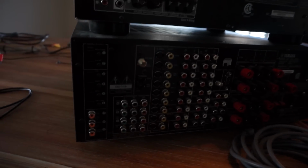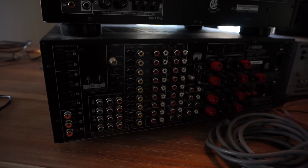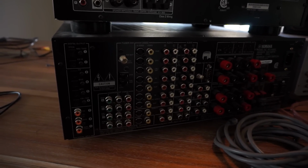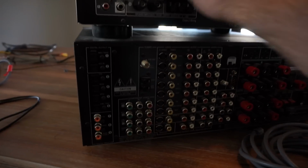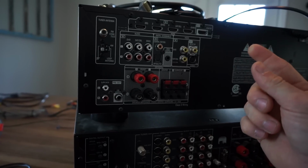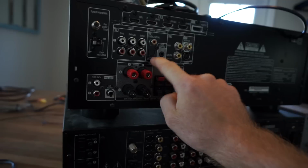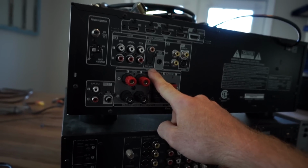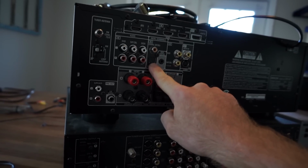So really pay attention to what you're buying and how you're going to connect it. I'd say if you're going to go buy something, make sure it's going to connect correctly. You can look up the user manuals online and see what it needs. Most likely on a TV you're going to want to have HDMI connections and opticals. If you're using smart features on a TV, you're going to need the optical cable anyway, because in that case the TV is the source providing all the video and audio, and you're going to need an audio cable back from the TV, which will normally be an optical. So if you're using Netflix, for instance, you'd have the TV on and this set to the optical TV input on this receiver, with an optical cable from the TV output to here.